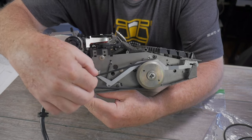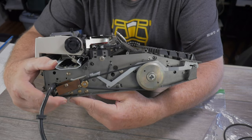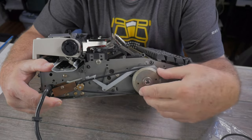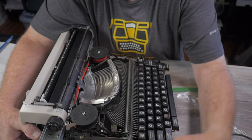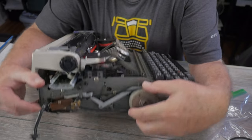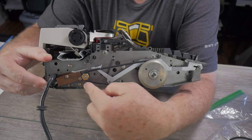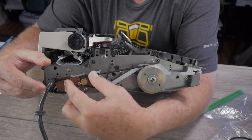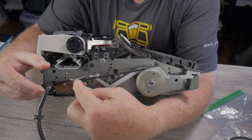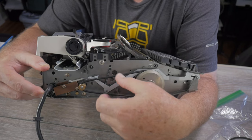I thought the tight O-ring was causing the type bars to operate too swiftly, so I found a slightly longer one — also an eighth of an inch thick but four and a quarter inches in diameter — a little bit looser. It works fine; the type bars move a little bit slower. There are also three screws mounting the motor to the side chassis, and I loosened those and pushed the motor toward the drive spindle to slacken the tension further.